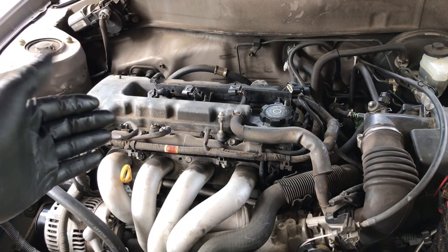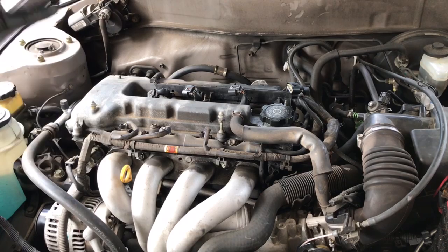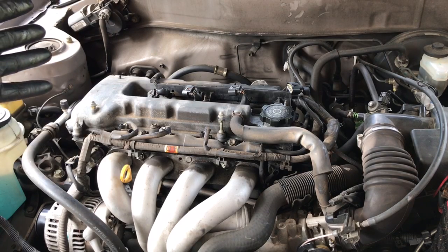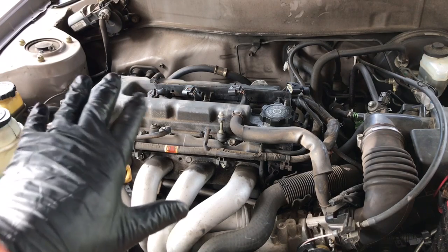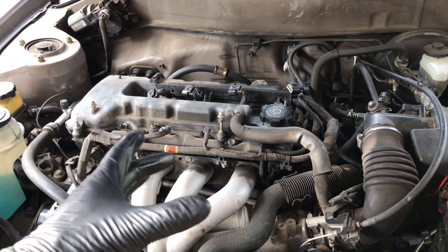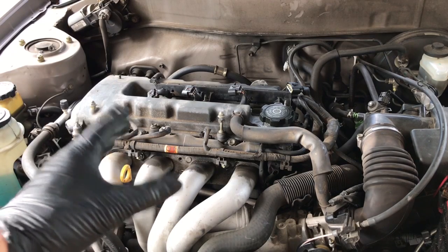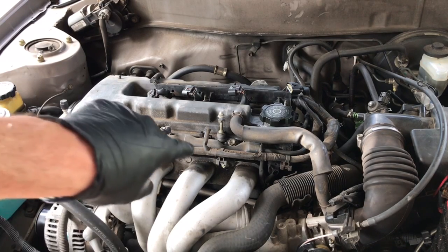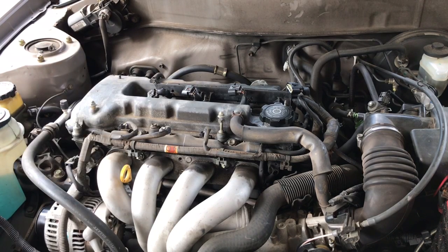And if it doesn't come up, then you know it's a valve problem or a head problem, or maybe another problem. You can comment if you know of another problem that would cause that. But we now know it's not a problem in the head, because when the cylinders are warmed up, I'm assuming the pistons swell, they're aluminum, they swell, and the compression gets better. And maybe since it was just driven, the cylinder walls are coated with oil.